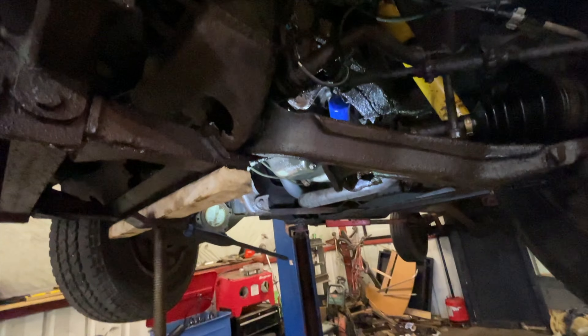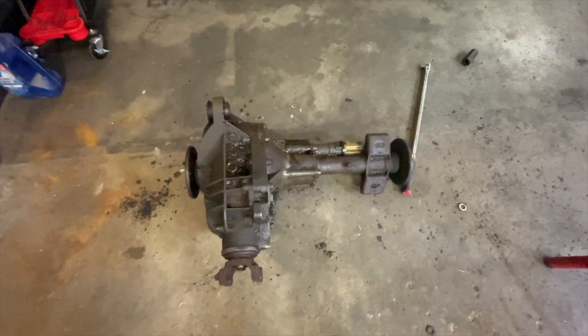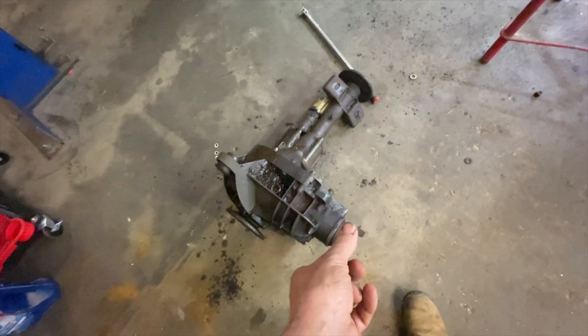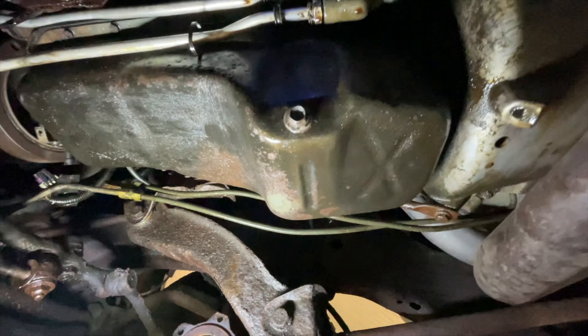It's a small investment - we're talking maybe $100 to $150 worth of parts and a little bit of time. What I've done at this point is removed the front axle, which was pretty simple to do. There are a couple of bolts on that flange right there, a bolt that goes through here, disconnect the drive shaft, one plug and unbolt the two axles. I left the axles in - they're sitting right here. I left the drive shaft in as well. There was one bolt right here, one bolt right here, and two bolts right here, and I was able to drop that down. Now I have a nice wide open shot at the oil pan.